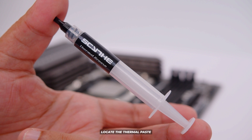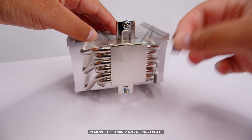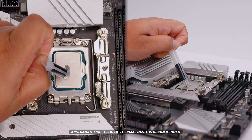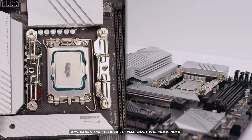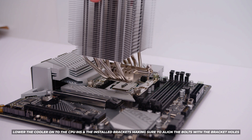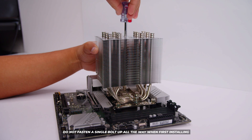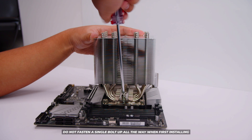Locate the tube of thermal paste. But before we install the cooler, don't forget this: make sure you peel the sticker off the bottom of the cold plate or you'll be in a world of pain much later. Thermal paste application for LGA1700 is slightly different — I recommend a nice firm line down the middle of the CPU, not all the way to the edges; it doesn't have to be the entire length of the chip. Now lower the cold plate of the cooler onto the IHS of your CPU, ensuring that the bolts pre-installed on the cooler line up with the holes on the brackets. Fasten both sides alternating — make sure you do not tighten one side all the way, because you won't be able to get the cooler seated properly.